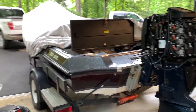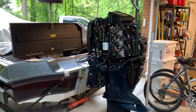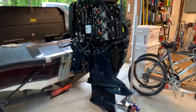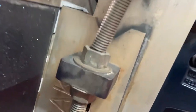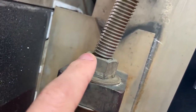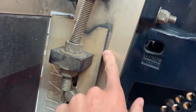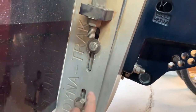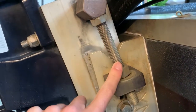All right, so as you can see we've got the boat backed into the garage right now. A lot of the engine panels are off because I've been working on it. As I did my 300-hour maintenance, I realized that my jack plate is worn slam out. You can see right there that that's like a half inch or thicker screw and that's snapped in half. You can see where this jack plate's moved back and forth and none of these bolts will tighten up, just because they've worn out over time, probably due to the jack plate moving because of these bolts.